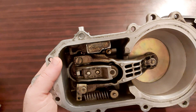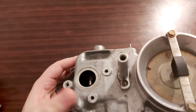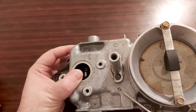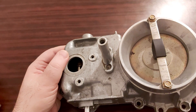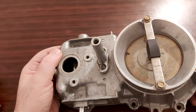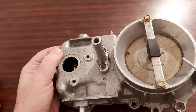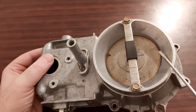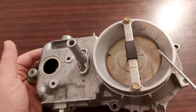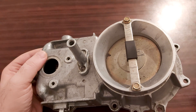There is a spring that preloads the lever here. Now, if out of some reason you get detonations, those can either break your sensor plate or make it skew. The sensor plate can go upward from where it should rest — approximately where my screwdriver is — and then you're going to get vacuum leaks.